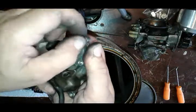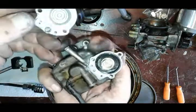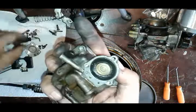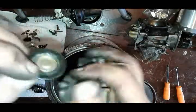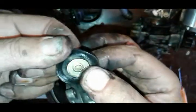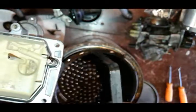There's also a spring underneath this cover, so hold it down. There's a little o-ring — you can see it right here, don't lose it. Then the spring and our acceleration pump. As you can see it's bad — if you can see right through it, like this little light area, it means it's no good. It's gonna be leaking or seeping fuel right through it, so that has to be replaced.